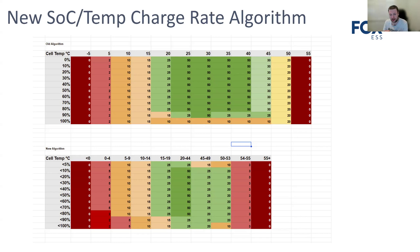The simplest way of looking at the charging algorithm: the colder your battery, the slower it will charge, and if it's a cold battery that's also nearing full — high state of charge — it will slow down even further. They are slowing the charge rate based on data to ensure battery performance and lifespan, and when we compare LFPs in cars we're seeing very similar charge curves in Fox now. I actually think Fox's charge rate algorithm has historically been too generous with charging amps in cold conditions at high state of charge.